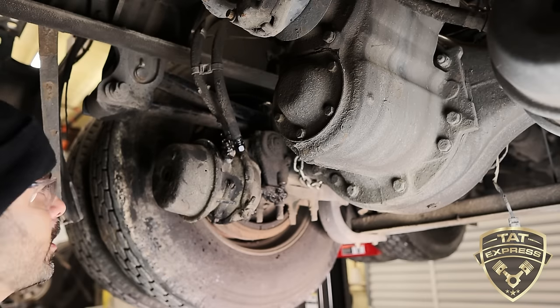Once we have that, our connections are going to line up just fine because we're using the same brake chamber, but I want to show you how to clock that. We already have the cage bolt on the new brake chamber if you're replacing it, and we're going right back on with the clevis lined up, everything going back in the same position. You want to line everything back up. Trust me, this is not easy if you're laying on the ground or any which way you're trying to do this. So take your time, make sure you're comfortable. We're going to be using the same hardware.